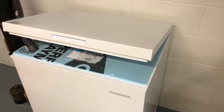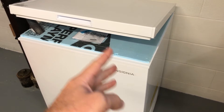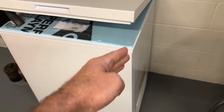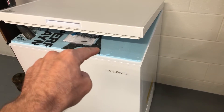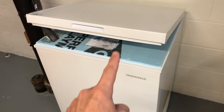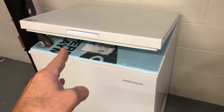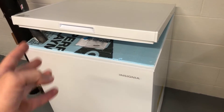If you decide to use an old or new chest freezer filled with water, you need to seal the seams with silicone — just like a fish tank. There's a drain at the bottom with a plug on the inside; seal that with silicone. The aluminum sheet on the inside has seams and you need to put an ample amount of silicone on those. You really have to do this, because water will get behind the aluminum sheeting and ruin the insulation between that and the condenser coils inside the walls — and it will ruin your chest freezer.